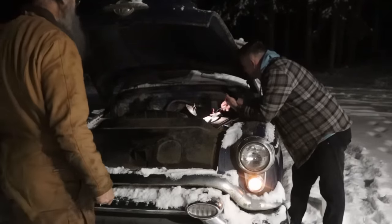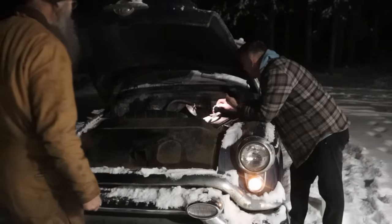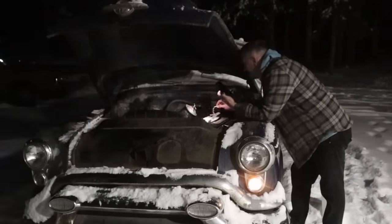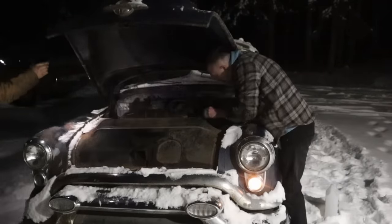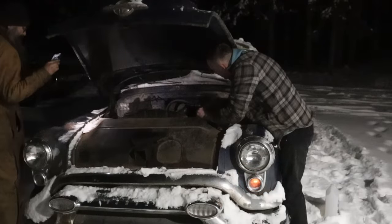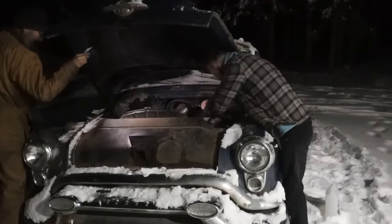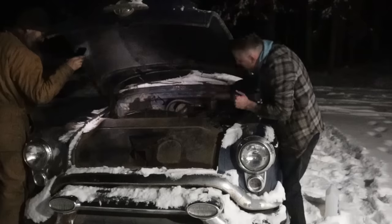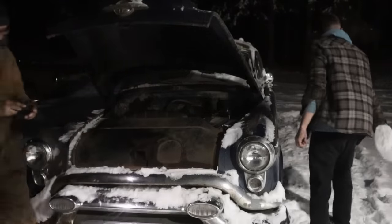Can you give it some throttle? I will. I want to keep as much gas on the throttle plates as I can before I open it. You gotta hold the light. Yeah, no, it just keeps arcing across everything. All the plug wires are arcing down here too. They're arcing to the manifolds. Yeah, that's exactly what's happening all the way across here. I thought they were pretty cool, but they are not working very well.